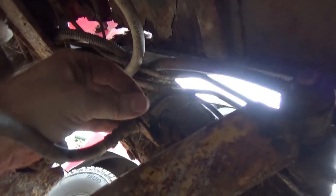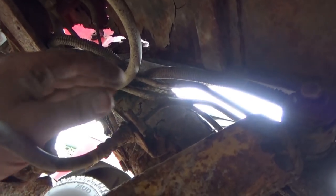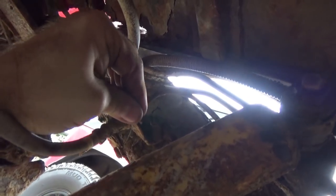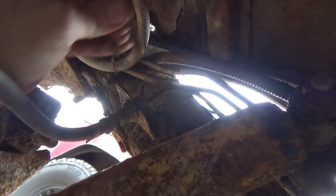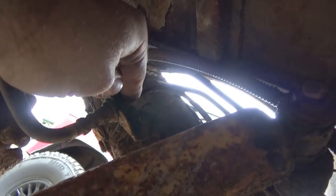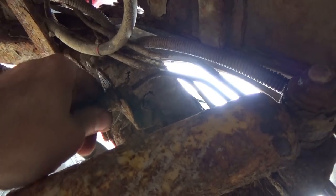And now we're gonna pull our brake line here. The soft line looks like it's good, so I'm gonna try to save it. Got this little flat clip right here, pull it out, which I've already pulled out for our channel locks. Get that out. Now the problem I'm having is this old rusty crusty line right here doesn't want to come out of the soft line.